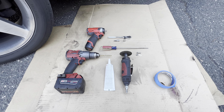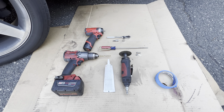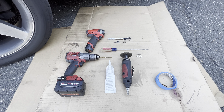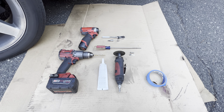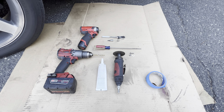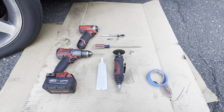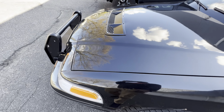Just take your time with it because it's two layers — cut the top layer first and then do the underneath after. It's a little pain but you'll get there. After I did that, I placed the heat extractor on top, made sure everything fits and lines up, then I used the RTV, wrapped it around the edges of the lip where it's gonna sit on top of the hood, just to make sure it's seal-proof so water doesn't leak from around the edges.